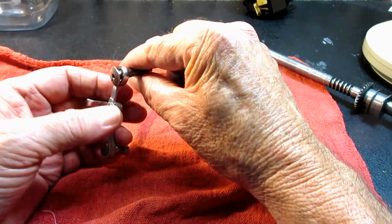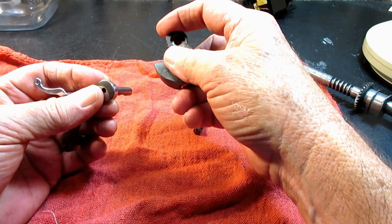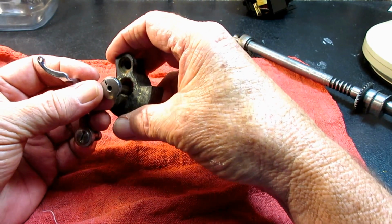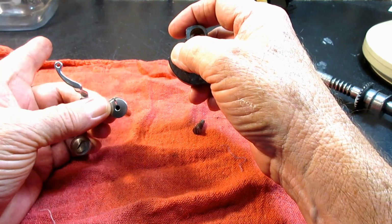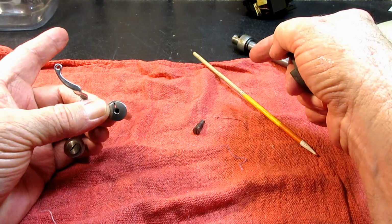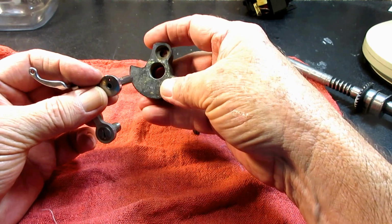And so a good lesson learned. And I should have known better, I think, because I'm very aware that when you hear a noise, it's not always where you think it's coming from. It could be something else. When you have a problem on one end of the machine, the cause can be totally at the other end. Just in the same way, you know, the needle bar and hook are on the left, but you change the timing on the right end of that shaft. So anyway, a good lesson learned.